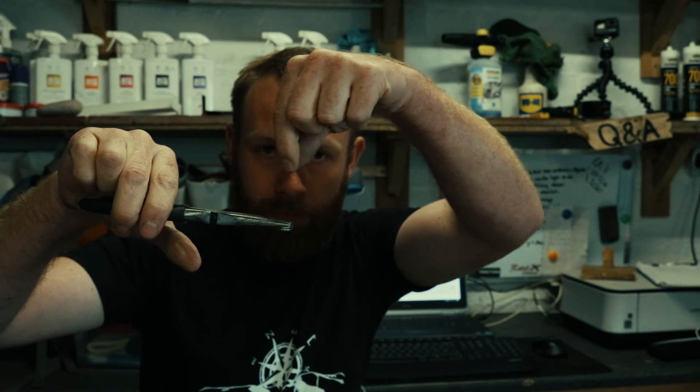That's the diff guards on — it's a nice easy job and they look great and they'll provide plenty of off-road protection. Two things to mention: make sure you leave all the bolts loose before you've got them all in, that way you've got a little bit of wiggle room. Also the two bolts that join the two pieces of diff guard can be quite fiddly, so if you use a pair of pliers to hold the nut you can get the top bolt in and screw it in — it's a bit easier that way. If you're interested in these guards by Rattlex, the website is in the description below. They also do a lot of other off-road protection and parts as well. Thanks for watching, see you next time.